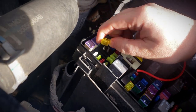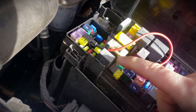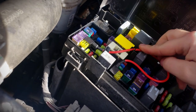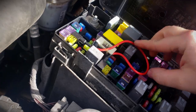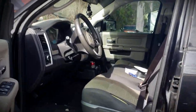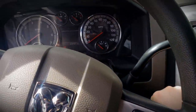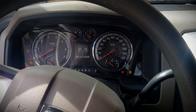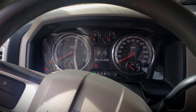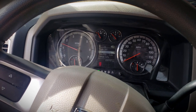Basically what we're going to do is bypass that prong and get power to the other side with this cable. We'll plug this into two slots in the fuse box, which is just power when you have the key on. So now that we know the fuel pump is good and pumping, let's see if the truck will actually start. Let's jump inside the truck and see if this thing will fire up. Just give it a second and let the fuel pump prime.